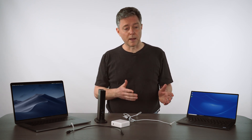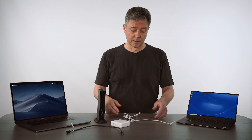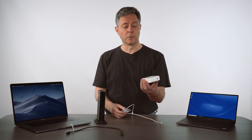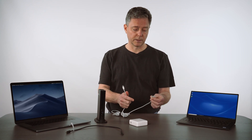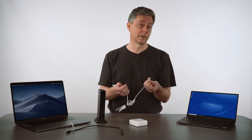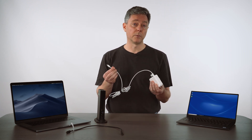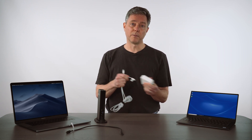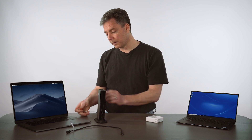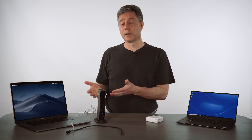However, if you set that cable aside and you've got a pile of USB-C cables and you just pull a random one out, this is what can happen. Right here we've got the MacBook Pro power brick, MacBook Pro 15-inch, and the charging cable that comes with it — because USB-C can carry a charge or can connect devices. Here it's charge only, and in fact Apple has created a charge-only cable that can't carry any data at all. So if I take this out and plug it into the dock and then plug that into the MacBook Pro, it fits, but it does nothing at all because this cable is only able to charge and is not capable of carrying any data signal and certainly not Thunderbolt 3.